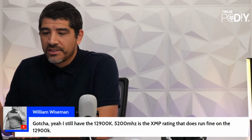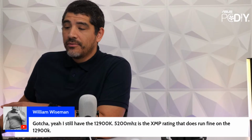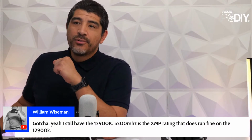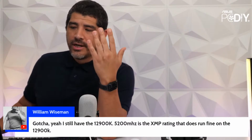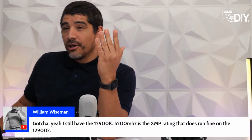So William decided to give a little bit of feedback. He says, yeah, I have a 12900K. 5200 is the XMP rating. Does the stuff that does run fine on the 12900K? Yeah, with the 12900K, like I said, if you make sure to update the UEFI, you could probably comfortably upgrade to, I'd say, 6,000 without any issues. You can maybe get a little bit more.